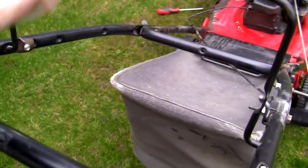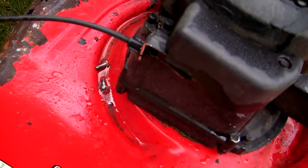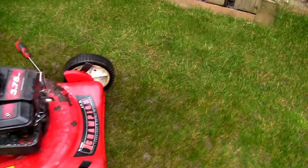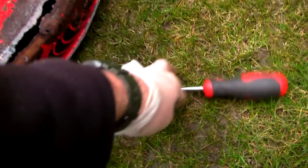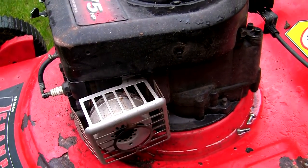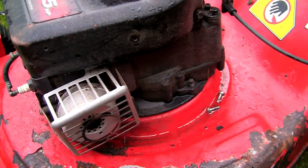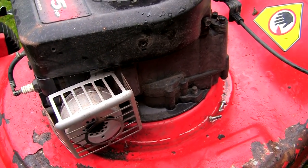I'll take all this sellotape off as well. This actually works fine — it operates the kill switch at the back. You see this cable that moves? That just moves the kill switch out of the way, which enables spark to go to the coil and then to the spark plug, which is about 100 years old. You must make sure when doing this that this cable runs through this notch — there's actually a little cutout it runs through. If it doesn't, you can trap it and break it. You need an exhaust guard as well. If you want to make your lawnmower a little bit quieter, you might want to change from this screw-in round exhaust to the rectangular one.